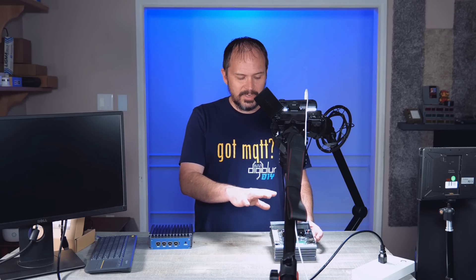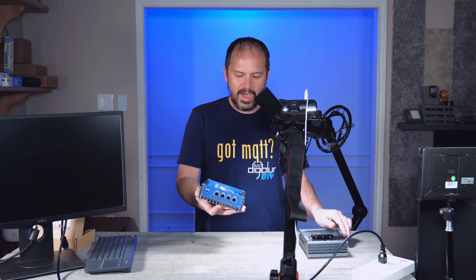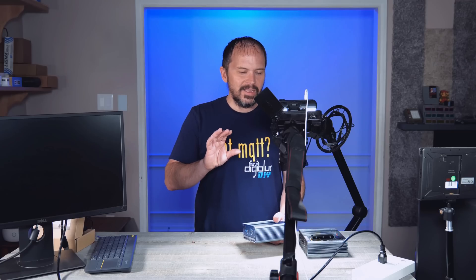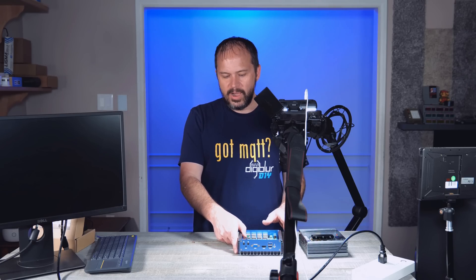It's overkill but not a bad thing. The cool thing is all four NICs are Intel i226-V. On my older model I have Intel i225 NICs at the B3 stepping, which is after they fixed that known problem. If you're running OPNsense on something else, make sure you're using Intel NICs — I highly suggest it for routing, it just works. I prefer bare metal; I don't want my router going down if I reboot my server.